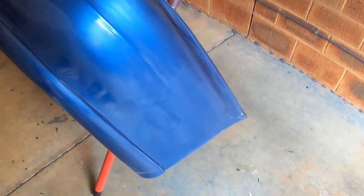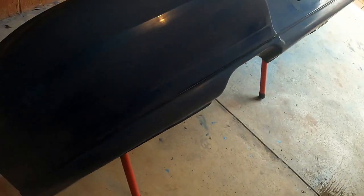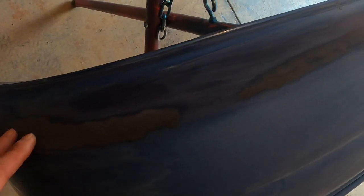As you can see, this is the rear bumper. It's sanded — all the chipped paint, all the creases, all the imperfections were sanded. I haven't completed the whole wax and grease removal; I've only done a quick round just so I can see if it's clean or not. This area is the most significant that has damage. I sanded it properly and had to start with 80-grit then move my way up. Ideally it's not preferable to start with 80 because it leaves a lot of scratch marks, but it needed to be done because there was a lot of damage — and some cheap paint on top without proper preparation before, so the paint didn't stick properly and it was nasty.